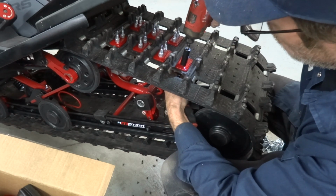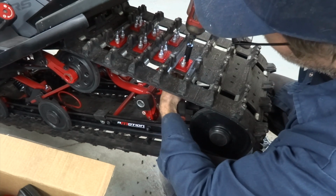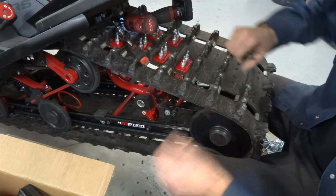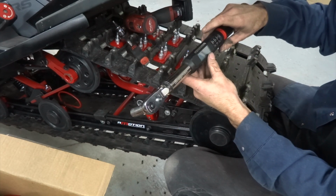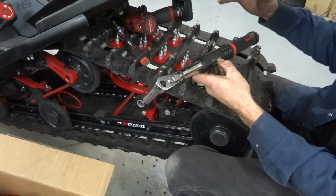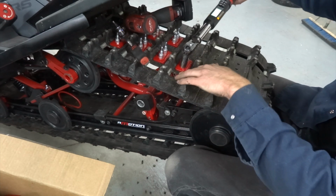Okay, so I know this is not over torquing, so instead of going by hand, I use my electric impact, and I'm going to torque these to, they say 30 Newton meters. I think they even say 40 in the Woody's instructions. I think it's a lot too much. I put it at 29 Newton, and the rubber wants to squeeze out of the backers.